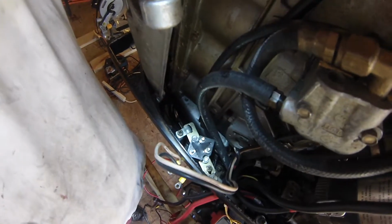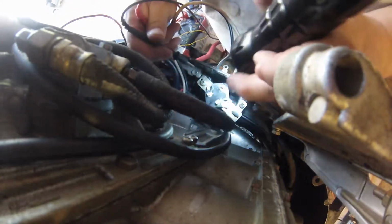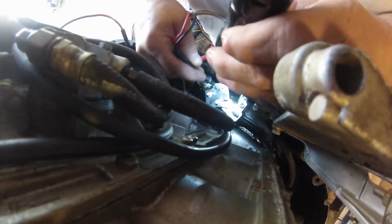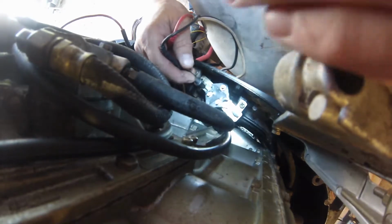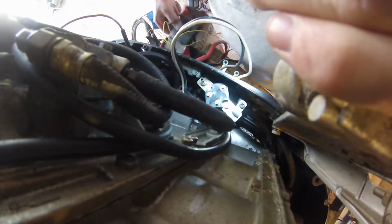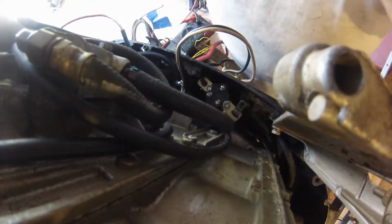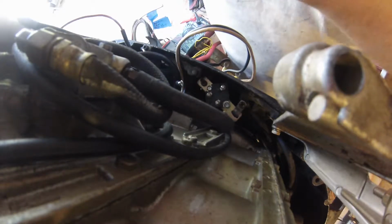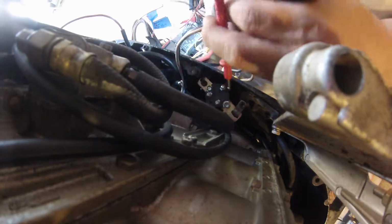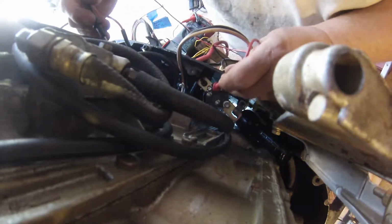So now where we're at is checking this guy, which is the solenoid. The alternator, because I just want to make sure I don't send an over voltage to that. Check, this is my rectifier. It's the same thing that's in an amplifier basically, but essentially it's diodes. So anyway, the best way to check it is to take your meter and put it on the diode. So if we put our negative, I'm sorry, yeah, our negative on ground, and then see if I can rig this where it'll give me enough light. Yeah, I should be able to see that.